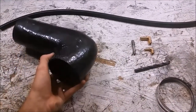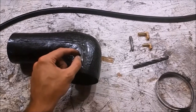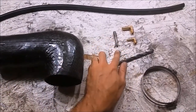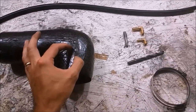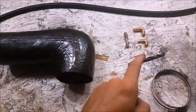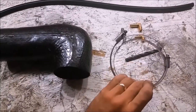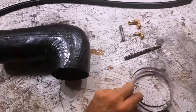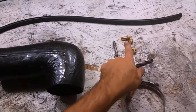I've selected two spots on the underside where I had drips with a little extra resin — that'll make a much stronger mount. It also hides the fittings underneath the intake, so it's a win-win. I've got my 1/8th NPT tap and I'm going to try to get a little thread going so I can thread those in and then epoxy them in. The idea is an interference fit between the intake and the fitting. I'm also reusing the nice BMW clamps and ordered two more from Turner Motorsports, and we have a silicone hose to replace the hard line on the 3/8th inch barb.